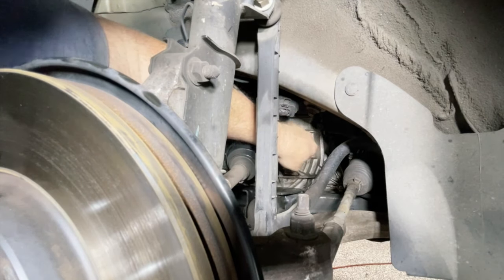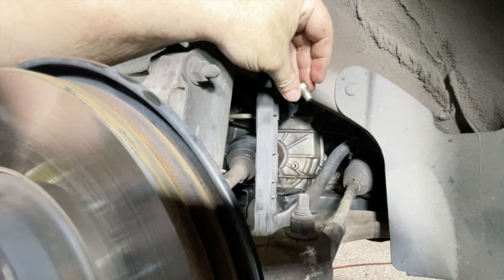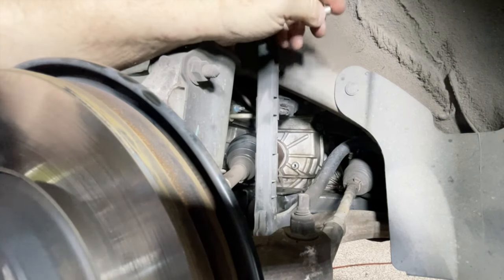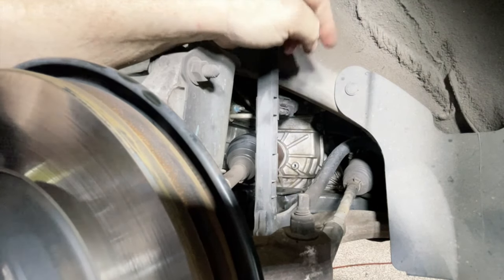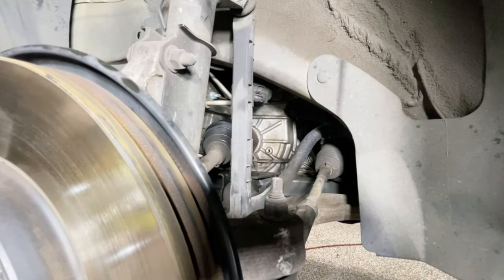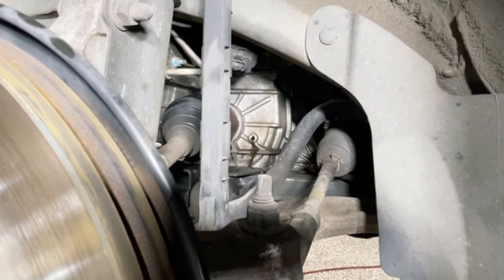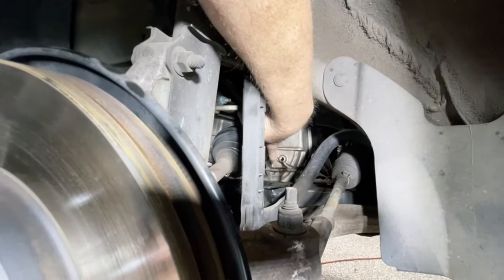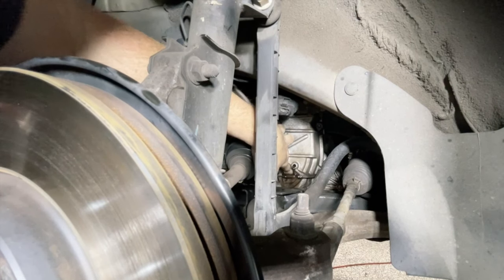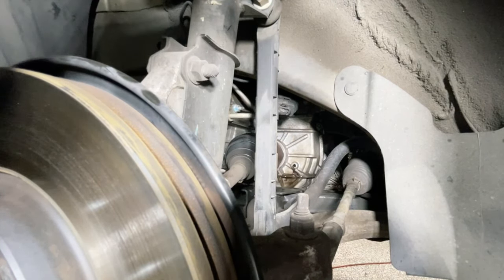So be prepared to catch something. With that bolt removed we can see that fluid is not running out, so we're going to top it up a little bit more. I'm going to top it up from under the engine bay and you will see it get to a point where it starts to run out the bottom. You can see now a little bit of that transmission fluid has just started running out, so put a little bit more in just to flush it through. I'm just going to let the excess drain off and then we'll put this plug back in.